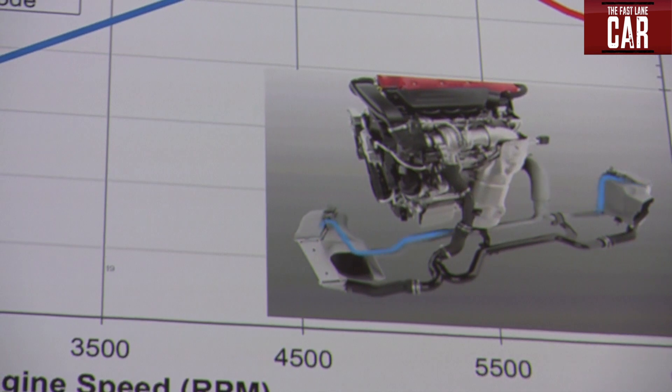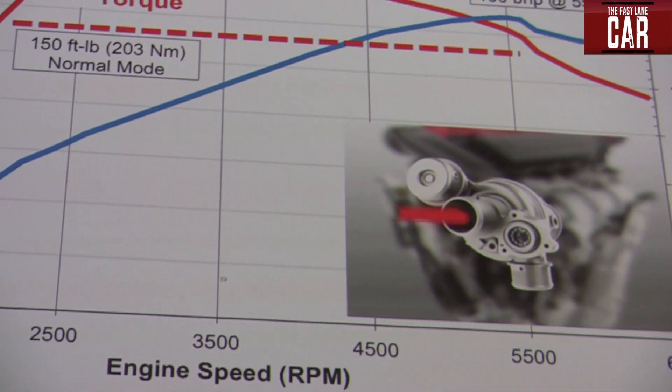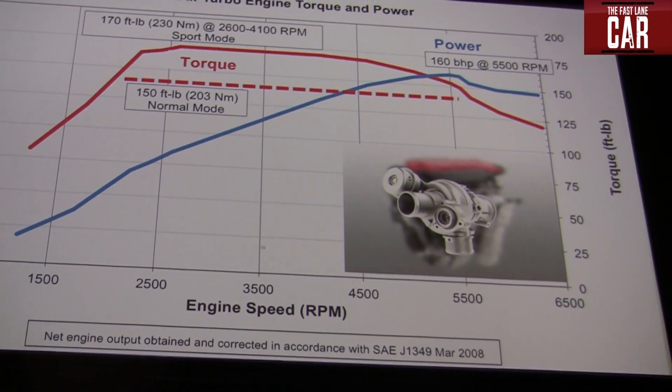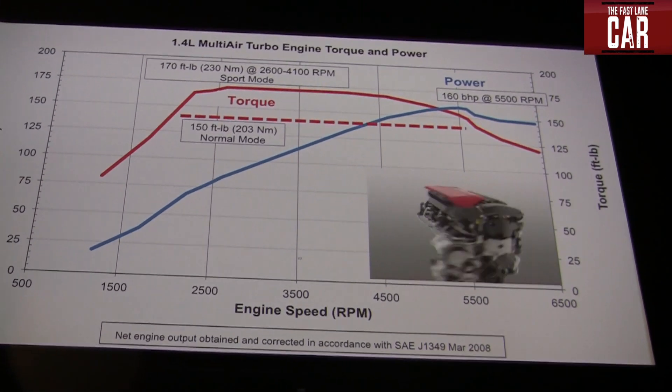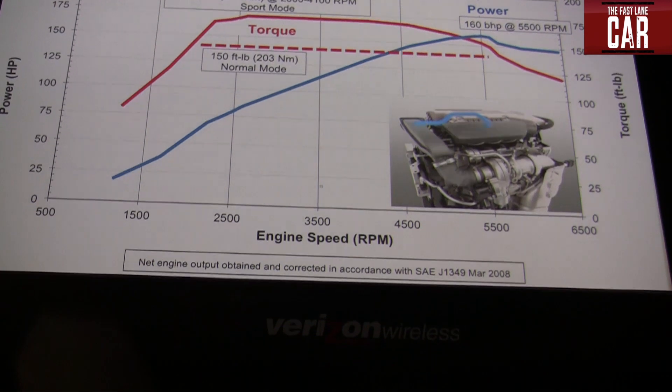Finally, you can do what's called a multi-lift: open, close, and open again in the same cycle — all in the goal of controlling the airflow. The fifth mode is used during deceleration, where we can go to complete intake off mode.